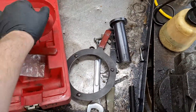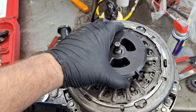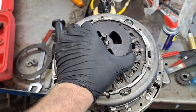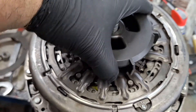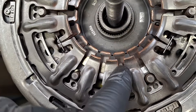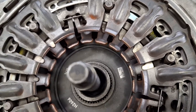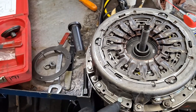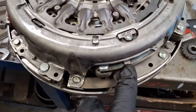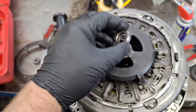Okay, there's the first tool — it's off of there. Now you're going to take this biohazard-style tool. Find out where it slides in — it's one way, you'll feel it. It has three sets of these four tangs on it and it'll slide down inside the pressure plate for the first clutch that we locked. These four teeth contact the pressure plate tangs that have those locks on them — those little silver tongues. When the pressure plate's pushed down, it's going to let those tongues pop into holes that are on those tangs, and once they're in the holes it is locked. There's another red handle tool you need to use to unlock the clutch, and you're going to push on these right here — there's one here, one here, and one here. Go ahead and get this bearing down on here, get that ready to go. Finger tight.